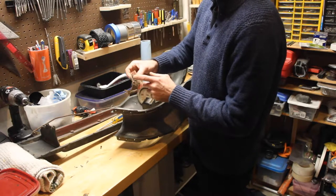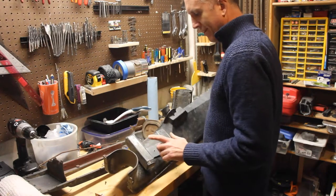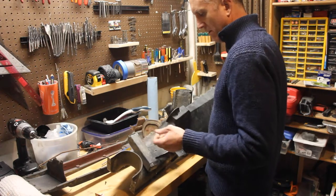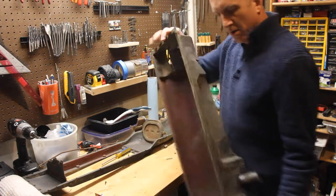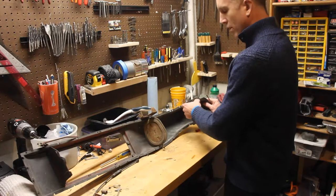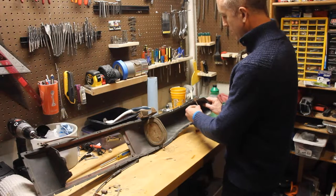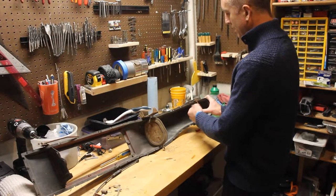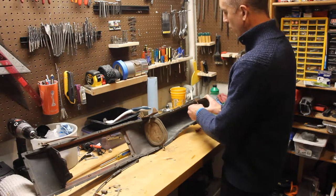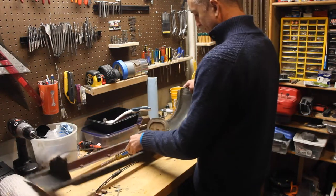These don't rust out — they're pretty good — but these are steel support posts. Now that we've got all the pieces off of the lower housing piece, I'll set the computer bracket aside for now. One thing to take note of: on this end where your resistor wires are — your defrost — there is a support post that goes across that is not mounted to anything. It uses the retention of the rivets to hold it in place. I believe this is here just for structure. Let's move on to the actual main flap.